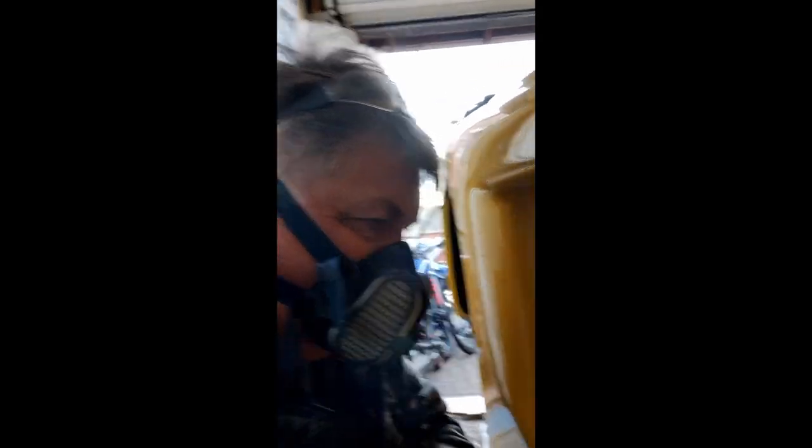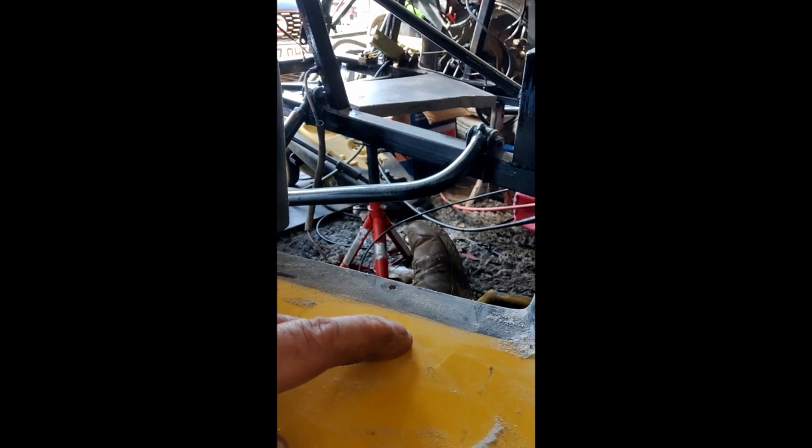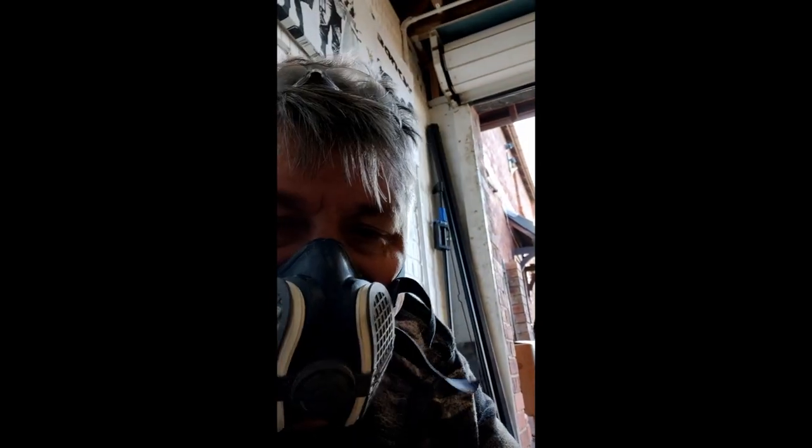Right, this is a very rare sight - me in PPE. The vents here, where these grills go, are too wide for the new radiators. So what I've got to do is cut off that black line with my little angle grinder tool. So I'm going to cut that off and then the radiators will be a perfect fit. On my own car I've already done that - I cut these off years ago but I forgot I'd done it. It's just a little modification and all it means is we bring the grills out an extra 25-30mm and everything's alright again.